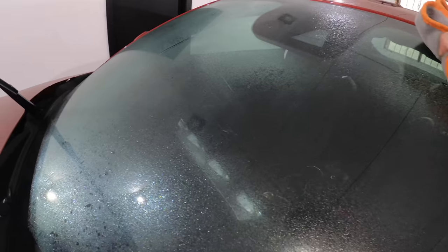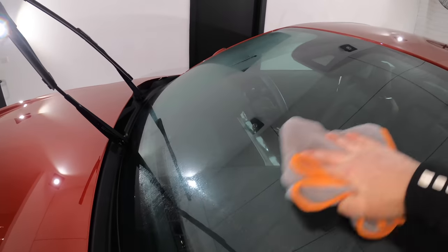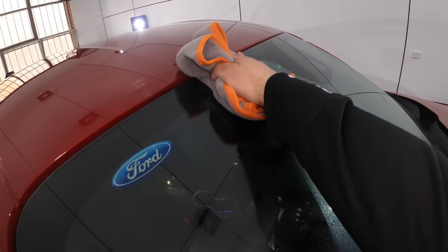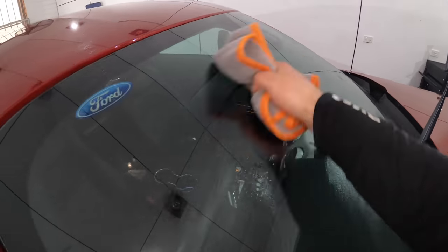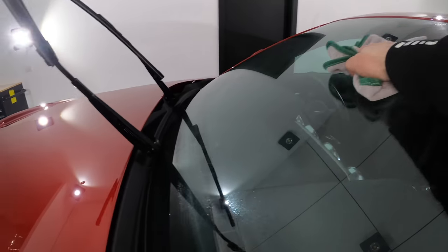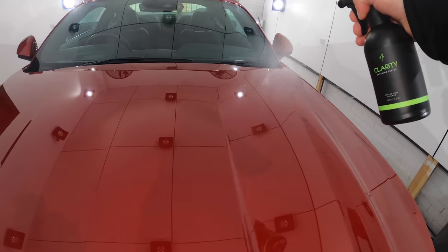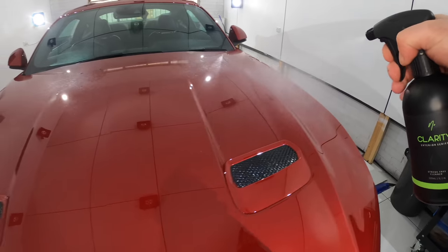And you have to remember that your goal for preparing the paint is to have it as clean and bare as possible before the paint correction process, as anything you haven't removed prior to this will negatively affect the next polishing stage. Think of it this way, you wouldn't open up your car polish bottle and add a few drops of car wash detergent and then a few drops of other chemicals such as iron, tar removers and degreasers and mix in a bit of dust, dirt and grime, because it's going to change the way that polish behaves, and not in a good way. So if you don't spend the time to thoroughly collect that thin layer of remaining residue, dust and surface dirt, you're basically just adding it and mixing it with your car polish as you begin the paint correction stage.